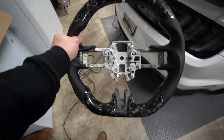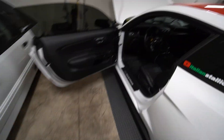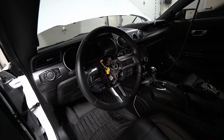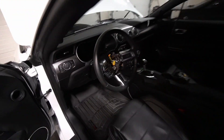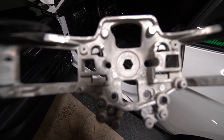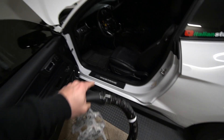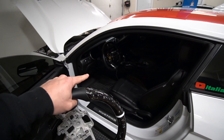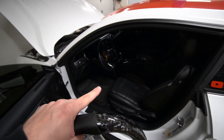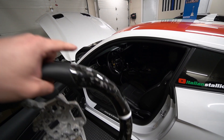I love the thickness of it, the grip — everything about the steering wheel is on point. I kind of jumped the gun on you guys a little bit, but I'm gonna walk you through what I did. It's one of the most boring and most difficult steps about this whole thing — the airbag. You're gonna see these two clips right here: that's gonna be the biggest pain about doing this job. There's one clip on each side, you've got to use a little screwdriver, push it in there and it pops, then you finesse the airbag ever so slightly and it finally pops out.